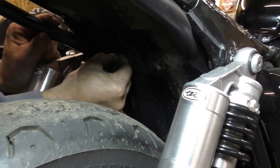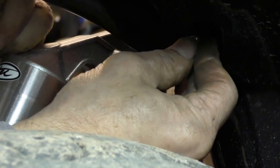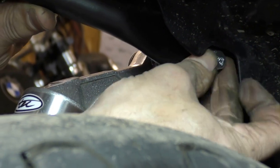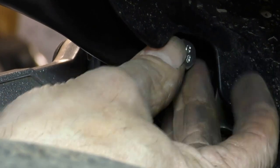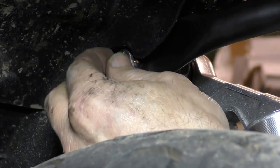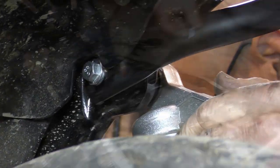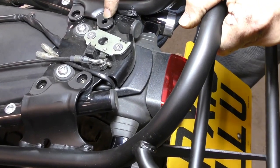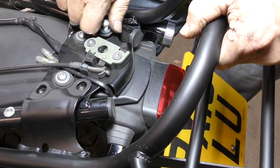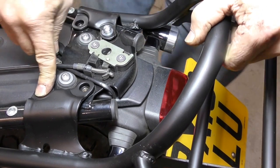So you just pop one of your bolts and washers in — don't tighten it up at this stage. It's a little bit of a fiddle to locate the hole, so just get that started for now. Don't tighten it; you do the same on the other side. You'll see three of these holes are large and one small. The small is the first one you locate with a small screw — that just pops in there. Let's just get everything lined up; the rack has obviously been designed with a bit of leeway adjustment.